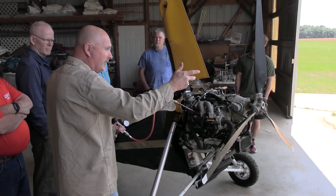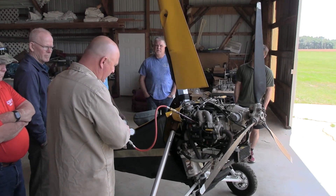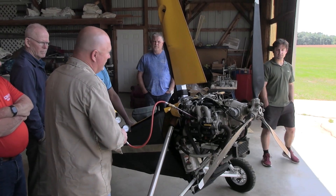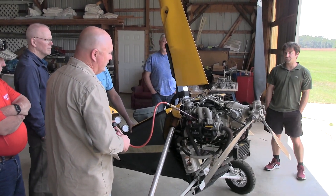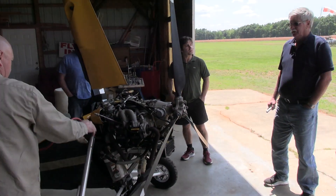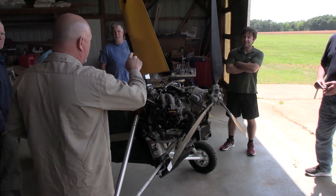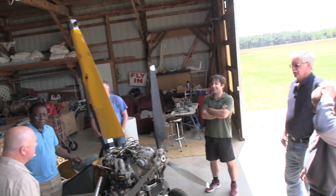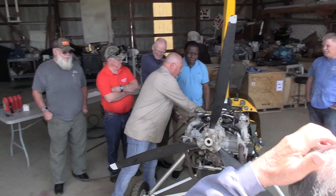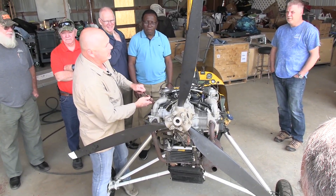You don't just hold it — you don't want to do that on a hundred-horse with 30-degree ramp action, because if you're off-center on the other side, it can pop back and take the prop out of your hand. You've got 30 degrees of it moving the opposite direction. You want to do everything you can to get it to top dead center. I own two continentals and I worked on them so much I sold them and got an engine I could actually fly.